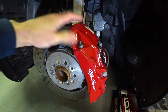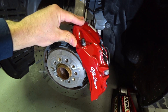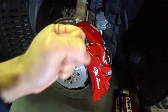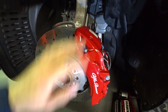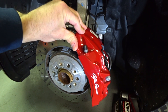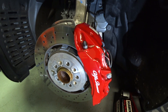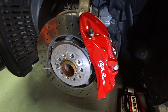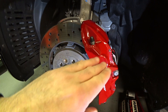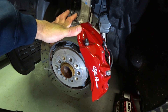Another thing some owners with these cars might notice: in race mode when you're in traffic, the torque converter on this car is spooled up so tight that the car is constantly lunging forward. I tend to find myself popping the gear selector into neutral because if you don't have very firm pedal pressure on the brakes, the car starts to lurch forward, and I just don't like that from a safety standpoint.